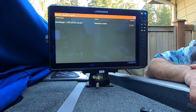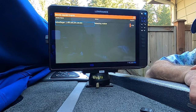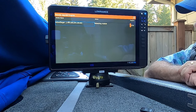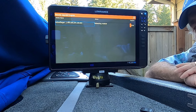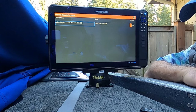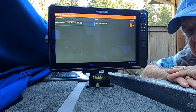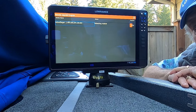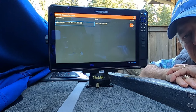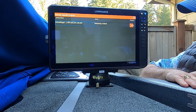There's now a progress bar for rebooting the module — it's up at 10%. Make sure when you're installing updates that your batteries are well charged and you've got clean power coming to your unit, because a power failure in the middle of an update can create real problems and might require sending it back to Lowrance. I also strongly prefer doing updates from an SD card rather than over Wi-Fi. Wi-Fi can work, but it risks getting your data corrupted mid-process, leaving you with an incomplete software update — just like losing power mid-update is a problem.